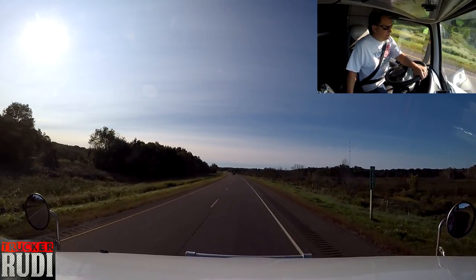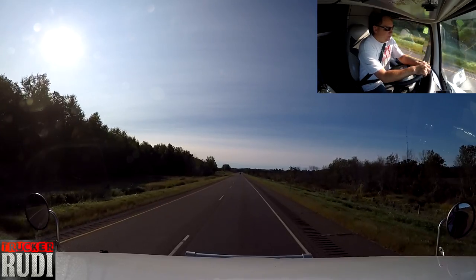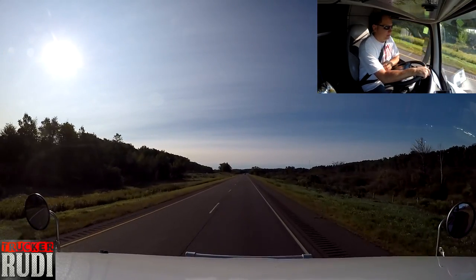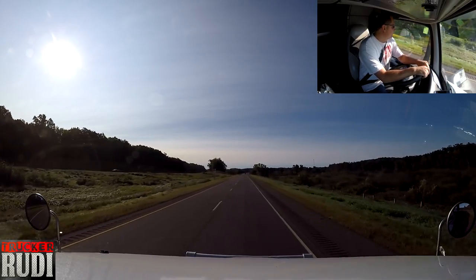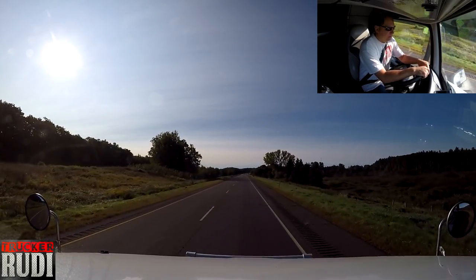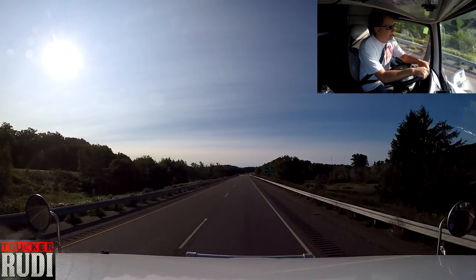So it's a good idea to do that every morning, make that a habit, so that your brakes are always adjusted. Unless a slack adjuster fails, then it won't adjust it, right? But I think it's a good practice to do that every morning. At least I try to do it anyways. But not everybody remembers to do it, but that's why I said make it a habit in the morning. But that's my tip of the day.